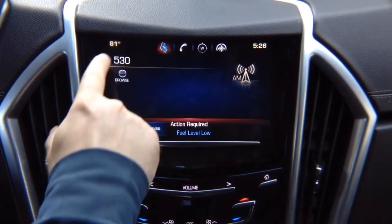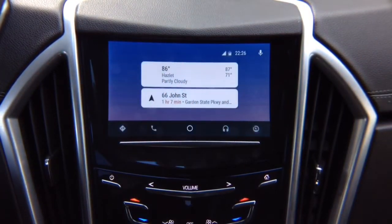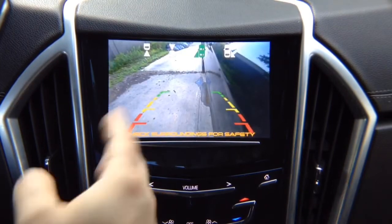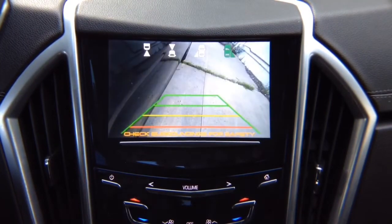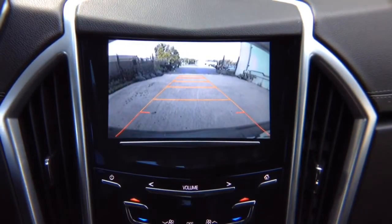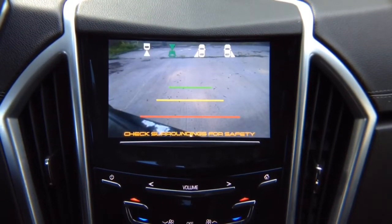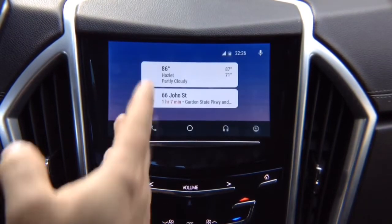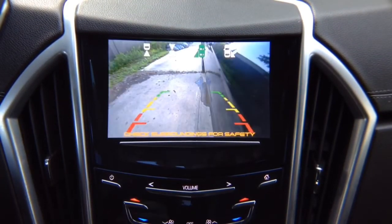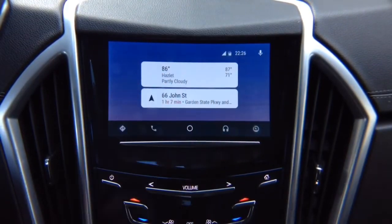If you're in interface mode using Apple CarPlay or Android Auto: left turn signal triggers the left camera then goes back automatically; right turn signal triggers the right camera; in reverse you get the factory or aftermarket camera; in drive you get the front camera. If you didn't install those cameras, nothing will switch — it will continue to show Apple CarPlay or Android Auto.